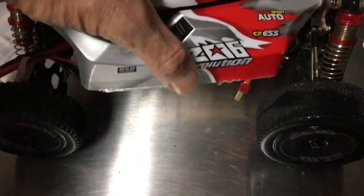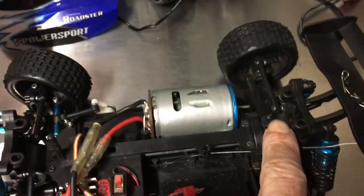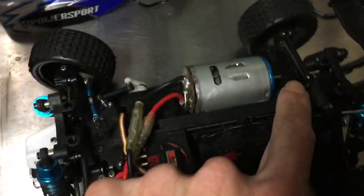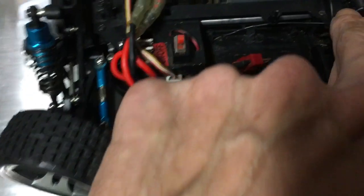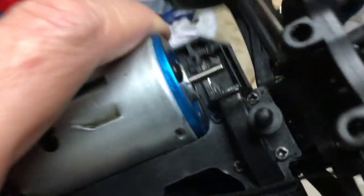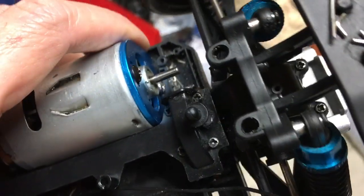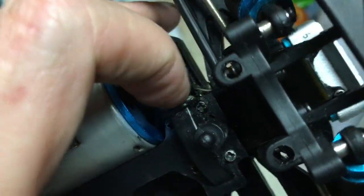You can either gain height by cutting the shell or by using the WL Toys 959 or 979 body posts, which are longer. Incidentally, if you're thinking of just swapping them with one of your WL Toys, the body posts from the WL Toys will bolt right on into here without any problem. I've only done the rear, however. If you swap them out — putting this post on the WL Toys — you're going to have to grind down a little bit because this thing runs right up flat against that gear cover, and that little ridge around the bottom you've got to grind down. Once you do that, it's no big deal. You may also have to make the pinhole a little bigger right there.